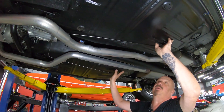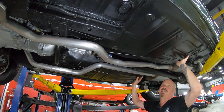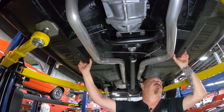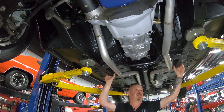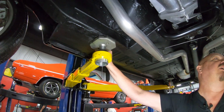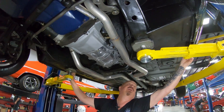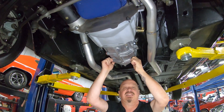You can see that the floorboards are looking beautiful and they've been coated with a bed liner material — this is a real smooth and easy to keep clean material. The frame is nice and square, not all squished from years of being jacked up with floor jacks like a lot of these Mustangs are. The torque boxes are something you check on every Mustang — these torque boxes are solid, looking good. Always look at the pinch welds too — they look good. This is a Tremec 5-speed, it's a T5, with the stock T5 bell housing. It does have a cable clutch on it.